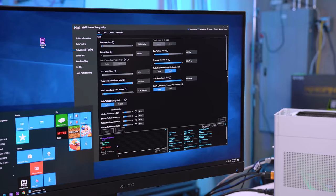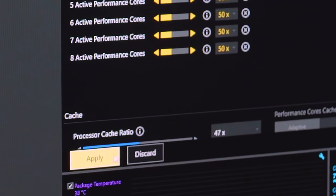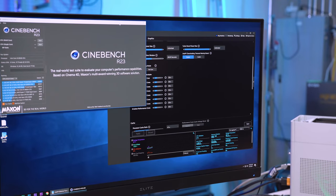This is where things can start to be a little frustrating. Even if 4.9 all-core is all we could achieve in Cinebench for Phil, that's already way more performance than he's used to with that chip. However, we're not done — we still haven't set a voltage offset yet. That initial crash, though — I never just take that at face value. I think that might have been a software bug. Let's replicate and see if 5.0 will crash again.